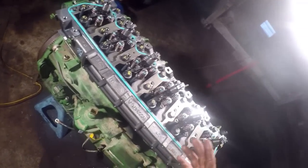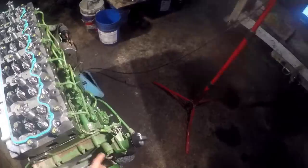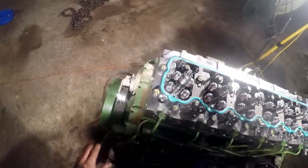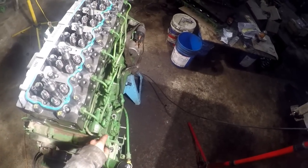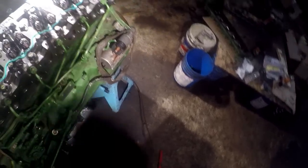And then after that, put the intake manifolds, exhaust manifolds. I got some paint. I gotta paint the cylinder head and get it shined up, and then the only other thing I'd really like to cover before I stick the engine in is I'll pull this plug and we'll make sure this pump, because I had this pump out of here in the field. I want to make sure this pump's timed right, and I'll show you how to do that. It's real easy with it out.